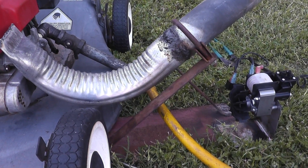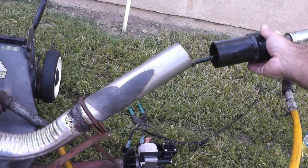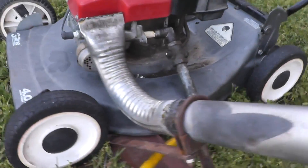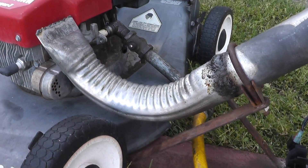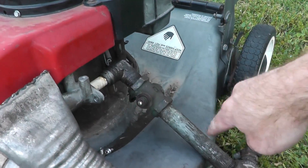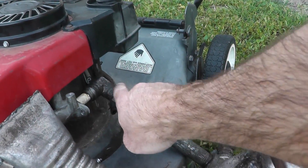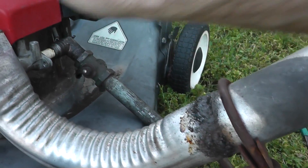The way this thing works is I load the reactor — I like to call it the reactor, that makes it sound scientific. I take this out and put oil in here. I dump the oil in and close this up again, then put heat underneath to start heating the oil. What this does is it cracks the oil and a flammable vapor is created when oxygen is passed through the heated oil. I have some plumbing hooked up that goes down underneath and ties into the feed. When the engine vacuum sucks air through this hose, it pulls air through the reactor, creates flammable gas, and then it's ingested by the engine.